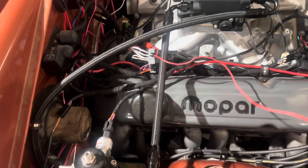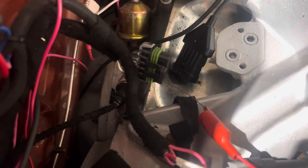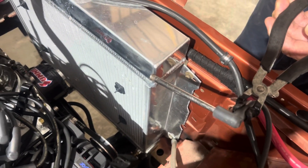We'll start this again once we get the test set up. We got our test hooked up. I've got a jumper wire hooked up to our white signal wire that should be running to our ignition box — it currently has an orange. I've got my coil wire here and we're going to ground it to that radiator bolt.